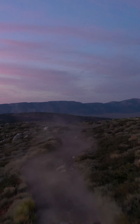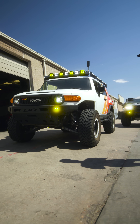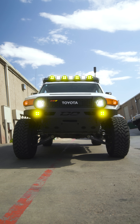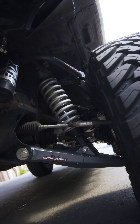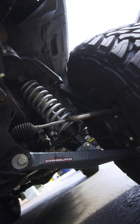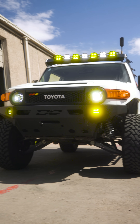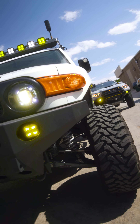You're going to do all your daily activities out of this truck and then pack up and head out. The FJ right here — let's talk about what you guys have done to this thing because it looks pretty beefy. So our FJ over here, the main mod that makes it stand out from our other trucks is the long travel suspension. Long travel means your upper and lower control arms are all the way out there, giving you the maximum travel from full extension to full compression.